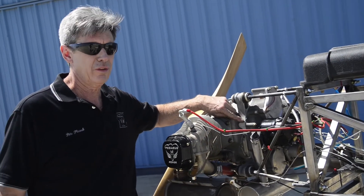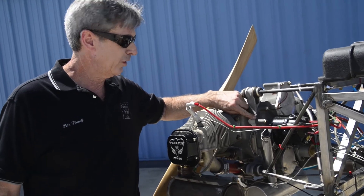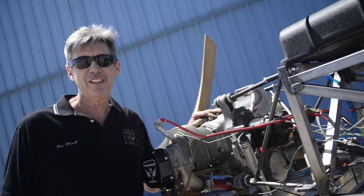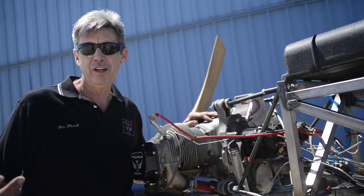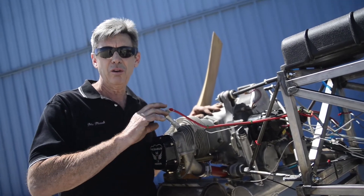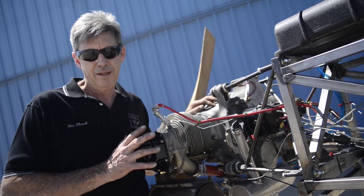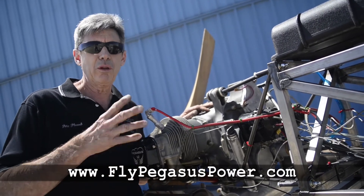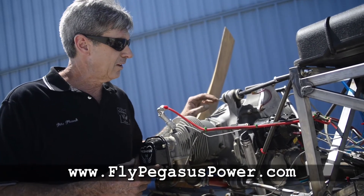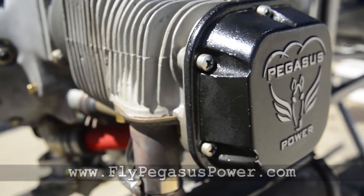I assembled the prototype cases with Yamabond, which I bought at the local Yamaha motorcycle place. It turned out to be really, really good stuff — it feels like a silicone base but is very easy to work with, cleans up nice, and it's a kind of gray color. The assembly grease I used was Lubriplate, bought at a local automotive store, coming in a tube — it's white and specifically for assembling engines. I coated all of the lifters, cam lobes, rockers, and pushrod balls with Lubriplate. It did come out in the oil after we ran it for a while and I was seeing big clumps of white stuff, then I realized that was the Lubriplate. It was very easy to use — you squirt some on, coat every part, and stick it together. It worked out really well for assembly.